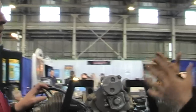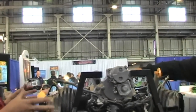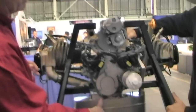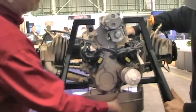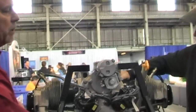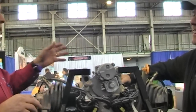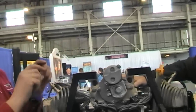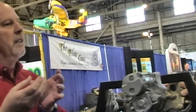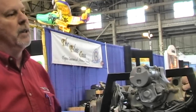Does that include, for example, exhaust and whatever? No, that's the basic engine you see. The sump is one thing we didn't really talk about — this is an aluminum fabricated sump. We're all familiar with the old steel kidney sump — that was an area where we saved some weight. Even accessory covers we didn't look at: the old block-off plate is now a piece of machined billet that's much thinner with strength ribs in it, machined lighter to get ounces — again, to finally add up to the pounds we had to reduce.